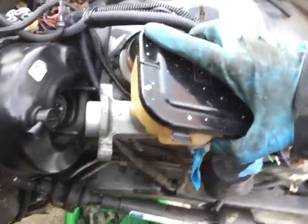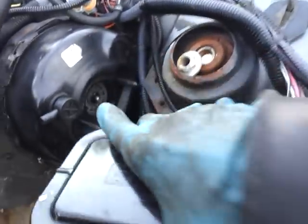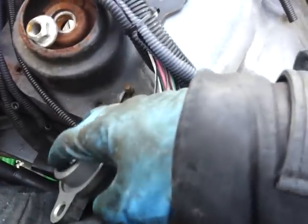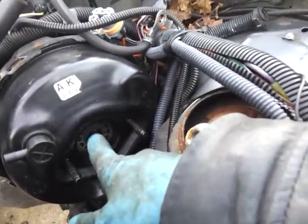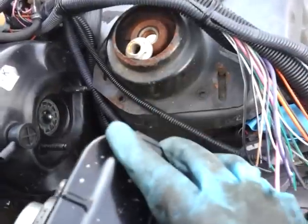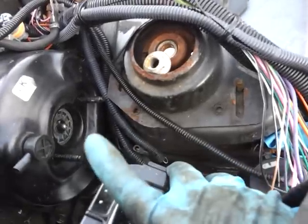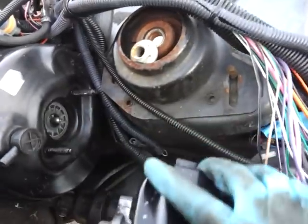This is what it looks like back here. You see that piston right there in the middle — that goes in and out when you press the brake. There's a seal on this piston, and if that leaks you can have brake fluid going inside the vacuum booster over there. If you pop it out and see brake fluid in there, that could be the reason. Also, if you have brake fluid loss and you don't know where it's coming from — and there's nothing at the wheel cylinders, no leaking on the brake lines — check this piece back here. That's a good thing to know.